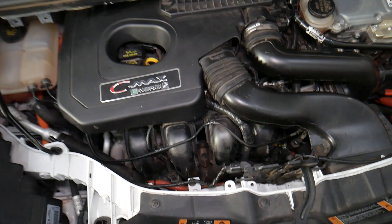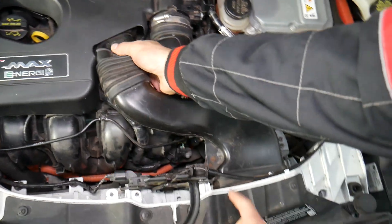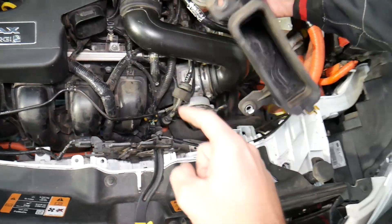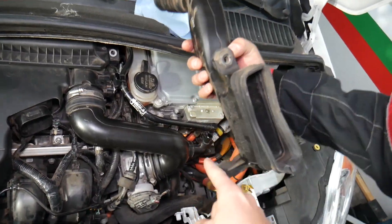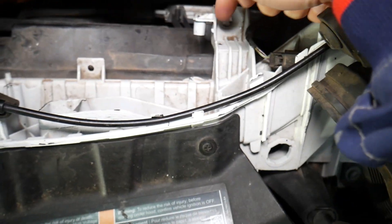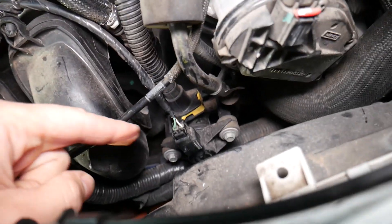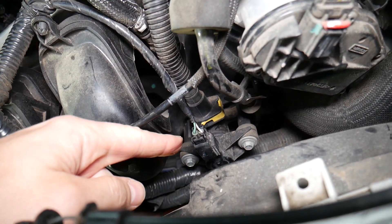This is the hybrid engine. If you remove your intake hose right here, it attaches with four clips to the air filter box. It has two bolts — which we already removed — that attach right here to the radiator support, here and here. Once you remove it, you have that device here known as a purge control valve.